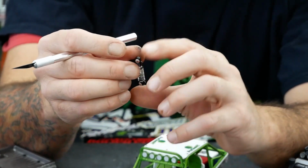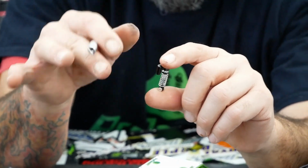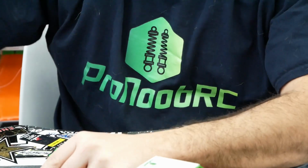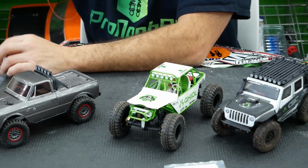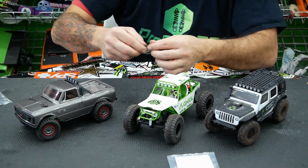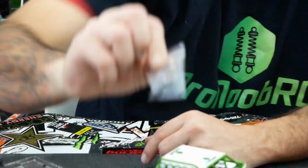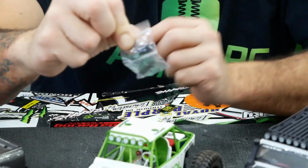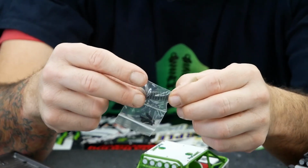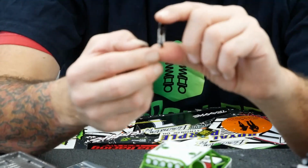You can change. Not really. That's a common misconception, that it makes your spring tighter for your truck to not bottom out. That actually just raises the height of the vehicle. So the one nice thing about these shocks is they do come with another set of springs. Now, what we don't know is if these springs are heavier or softer than the silver ones.